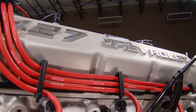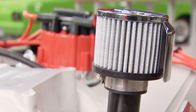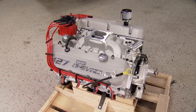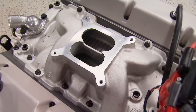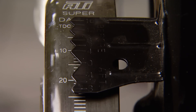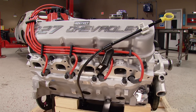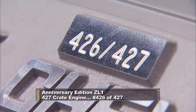Chevrolet Performance knew that this legendary power plant was close to the hearts of many muscle car enthusiasts, and in celebration of the 50th anniversary of the big block Chevy, they refurbished the original tooling to produce the ZL1 engine and created a limited series of 427 crate ZL1s. Starting with the aluminum block employing 4-bolt mains, a forged steel crank, rods, and forged aluminum pistons, this setup offers a final 9.5 to 1 compression ratio, making it pump gas friendly. It also includes a high performance hydraulic roller cam, aluminum roller rockers, aluminum oval port heads, and a matching aluminum oval port high flow intake. Claiming 430 horsepower, that's likely a fair underestimate. Each is numbered — and we got number 426 out of 427.